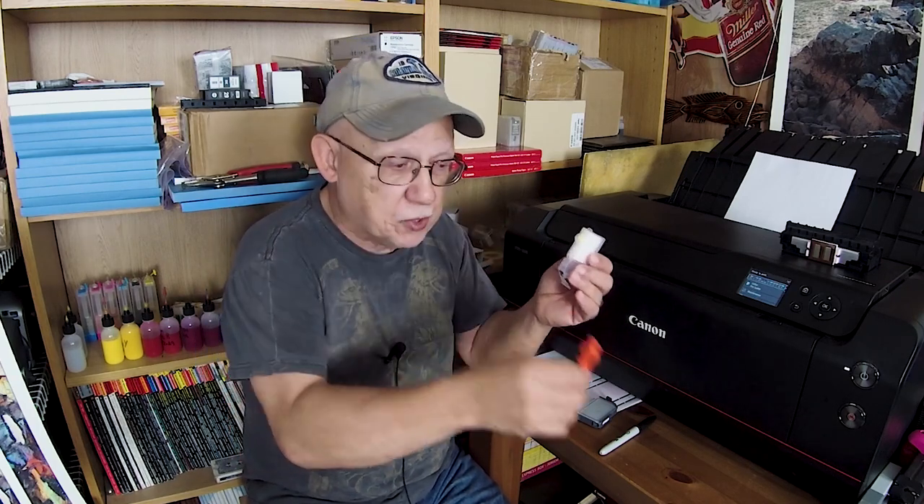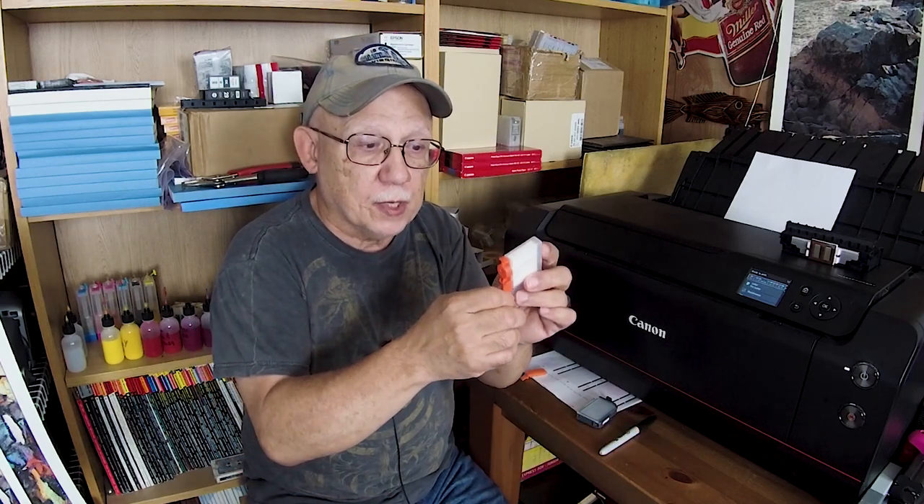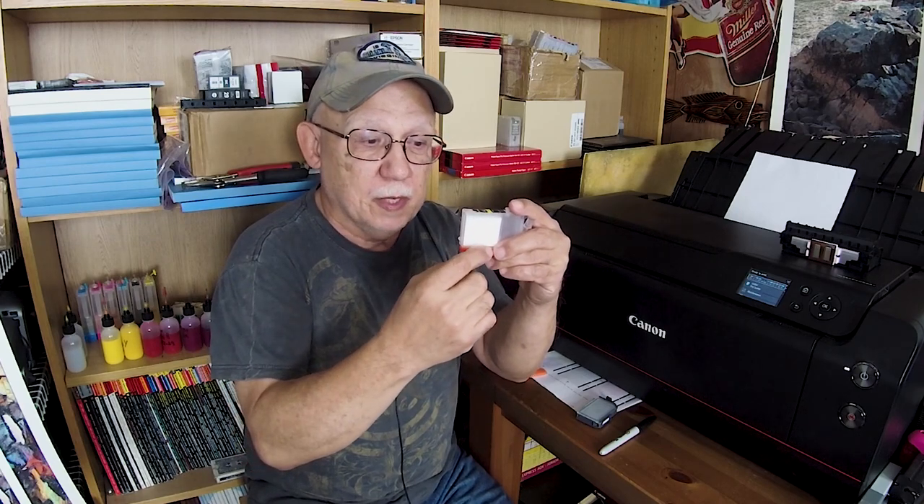Apparently they were not careful. They took off all the clips, laid them out, went ahead and reset the cartridge chip, put the clip back on — but they put one that had a couple of drops of cyan ink on it. Of course, when yellow ink started to permeate the sponge, it created a nice green artifact. The photo I saw literally looked like broccoli growing out of the exit port of the cartridge.